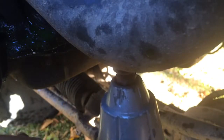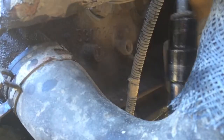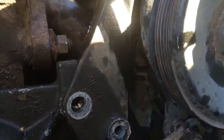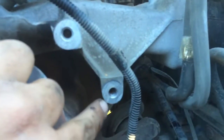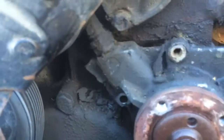For those of you watching at home, there's a bolt hidden up there that you've got to take out in order to remove the power steering pump. I found one more bolt further back in the Chronicles of Hell back there — I can't get at it with the camera but I can try to get at it with the wrench. This was a lot of fucking around. There's a bolt behind this bastard right here that you have to get from this side, through a little hole in your power steering pump. You have to fully undo your power steering adjuster to get back there. Then you can pop off all the bolts on your water pump and it just pops off, and you disconnect the hose and it should come right out.